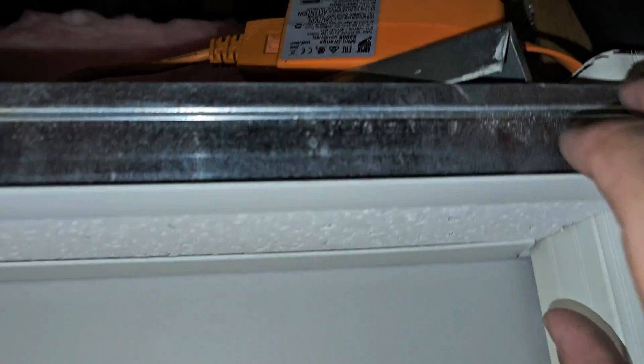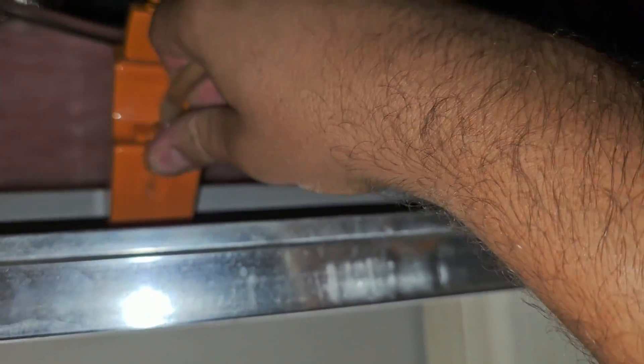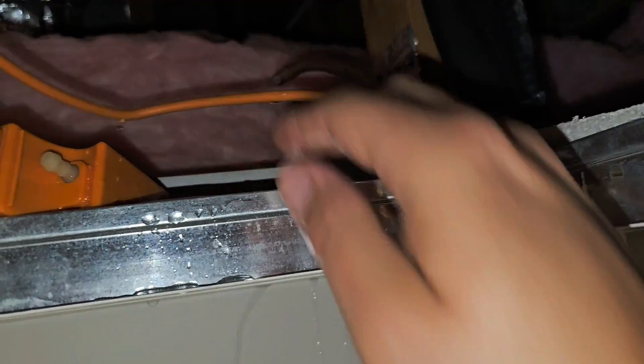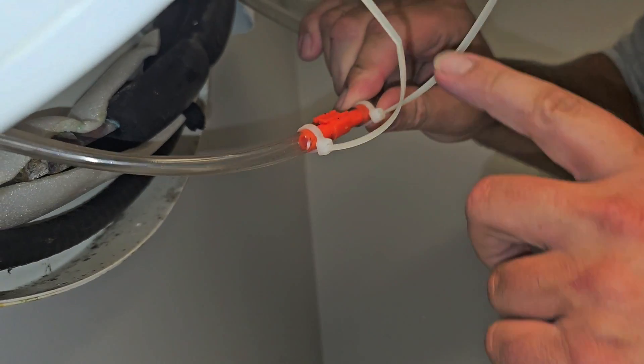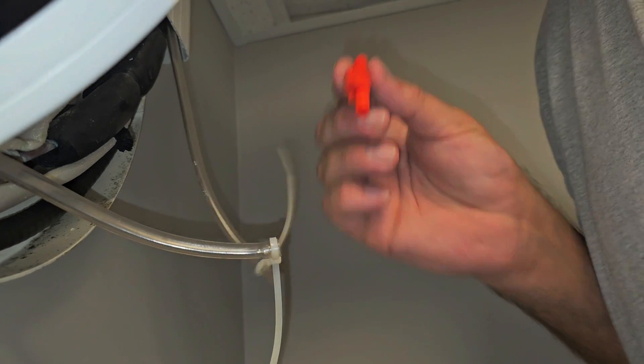Disconnect the sensing cable from the pump — pretty simple. Pull this out. There's the float assembly. This wire is loose. Now just disconnect the drain lines — quarter-inch tube. Make sure you use quarter-inch tube; do not use anything larger than quarter-inch tube. There's the pump. Now I'm going to take out the old anti-siphoning device — you can see they've got some wire ties on here. And there it is.